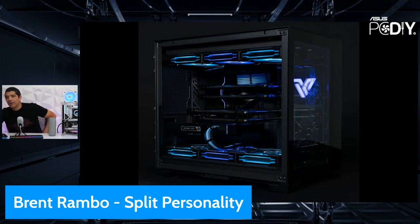In terms of hardware, 13900KS, this is an ROG STRIX Z790-I, an ROG Loki 1000-watt SFX-L based power supply, a 4090 based graphics card, 6400 MT kit of memory in there, 32 gigabytes, a 1 and 2 terabyte PCIe NVMe M.2 based SSD setup. That's all inside the O11. And then the Velocity 2 for the CPU and the GPU block, DDC EK pump. Also, the pump cover and rads and fittings are all from EK as well. And then the Lian Li SL120 Infinity fans. And then pretty much all the other things that you saw were all custom work there.